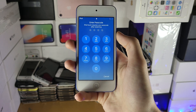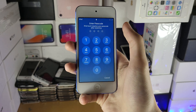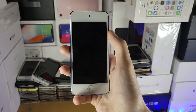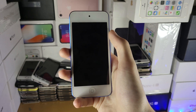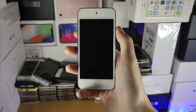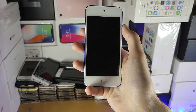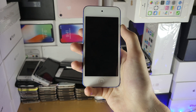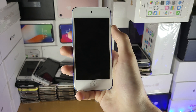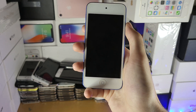However, if you plug your device into the iPad charger and that's not working, and the force reboot isn't working — something just isn't working right. What I recommend before you give up on your iPod Touch is to leave it on an iPad charger overnight. If there's any life left, you can narrow it down to a battery replacement, though you could buy one — they'll most likely be more expensive than the iPod is worth.